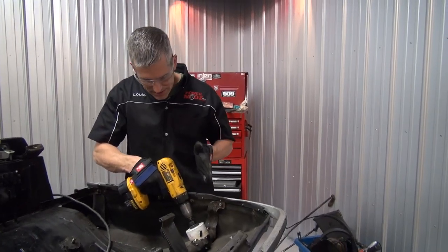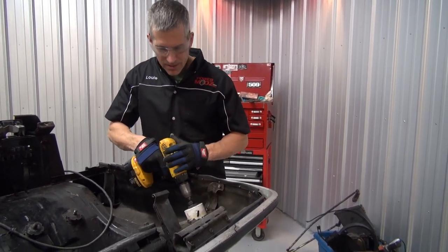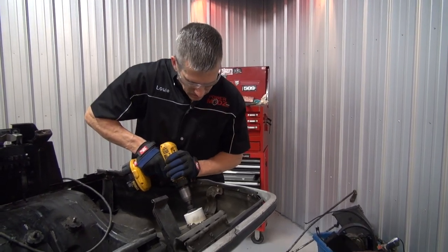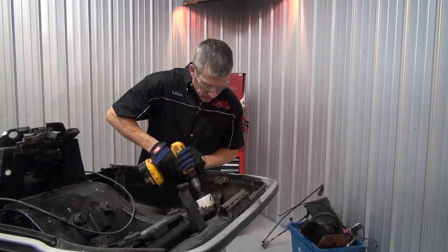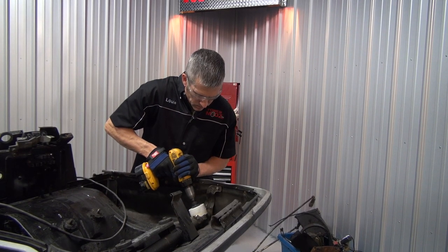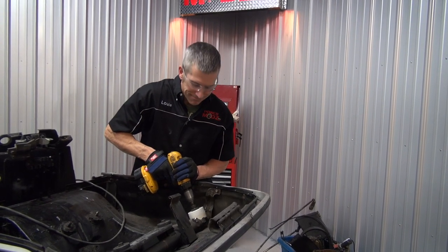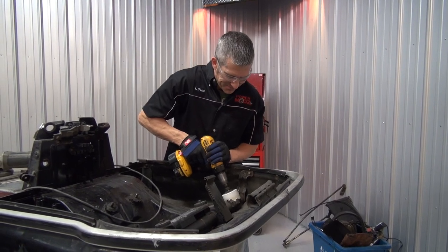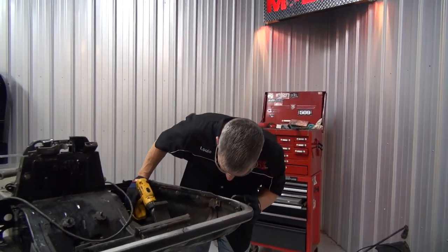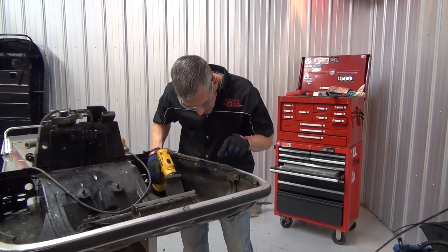I'm just holding this blade on the same angle that the old ski spindles went through. It's gonna give us the right kind of rake on the front of the sled. You don't want those pogos standing straight up and down. You kind of want them raked a little bit forward when you're riding. And yes, I'm eyeballing it. So we're that far, and we're getting held up on there, but I need that because that's my guide.